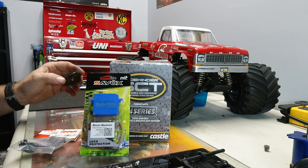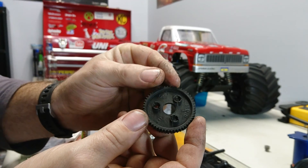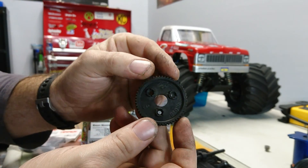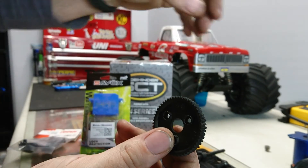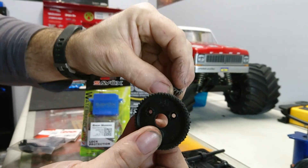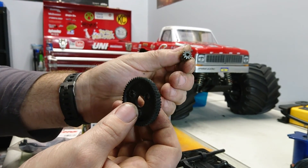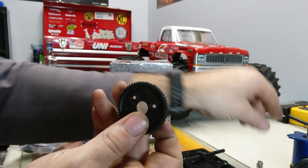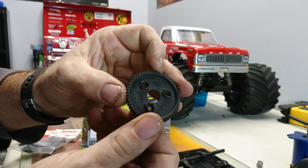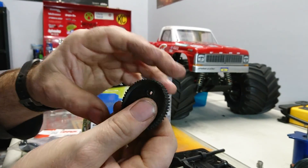Particularly — I don't know if you can see this — but that is my spur gear. This is a 54 tooth, this is a stock plastic gear. There were two things I was having a problem with. I believe with the cogging, I couldn't actually get my pinion to stay on — it kept coming apart. And then it actually tore and shredded this gear here.